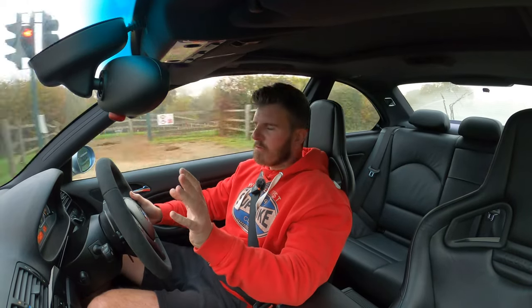So you've got to be a little bit careful, because obviously if I had run that, I'm pretty sure it would have started, but it would have ran very rich, because it would have thought obviously it's a lot cooler out than it actually is. So yeah, awesome, awesome stuff.